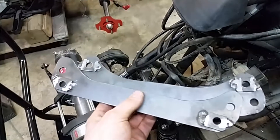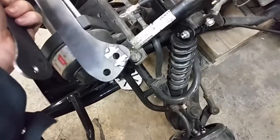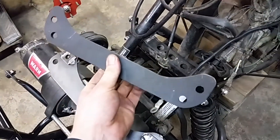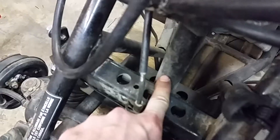Here are the lift kits I made for the front of my Honda Recon. This front part goes down to avoid interference with the brake line here, so it goes under it, and the rear part goes up to avoid interference with the steering shaft. Like I showed you in my little sketch,